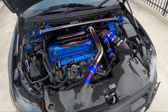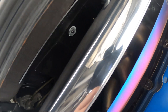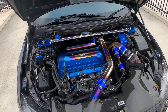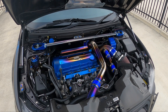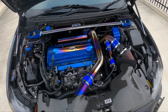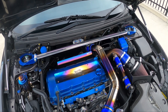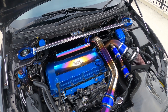And then you need to finish off your exhaust at that point because you're still going to have that factory downpipe or wide-mouth dump — let's say around $500 for that. Then you have a full turbo-back exhaust, injectors, fuel pump, your panel filter, your 3-port, and your intercooler piping. If you did that all at once and got your tune on E85, that's going to be about $4,800. If you used used parts, had some smaller injectors, and got a remote tune, it could be as cheap as about $3,000.